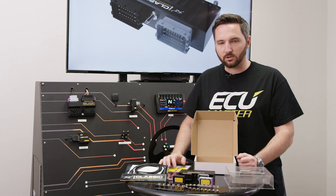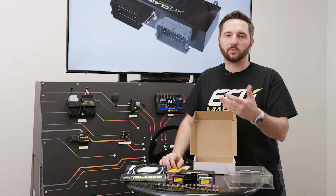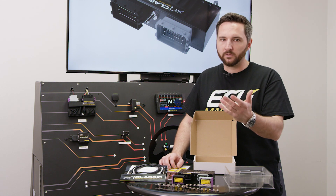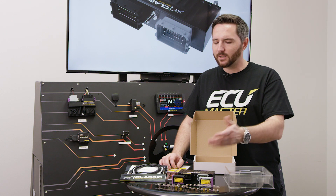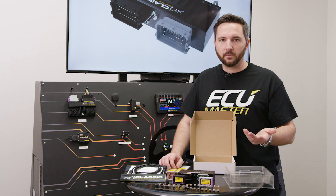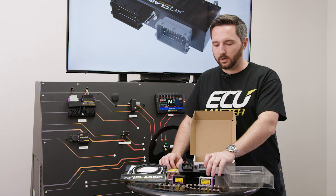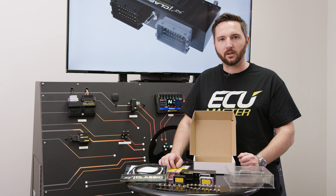The Classic is a great ECU. It has six injector outputs and six high-current coil outputs, so you can drive coils without an igniter, or drive up to 12 passive coils. You can also run up to 12 injectors — two per channel — covering anywhere from one to twelve cylinders, with up to two variable cams. It's limited to cable throttle without an expansion module; if you need drive-by-wire, you may as well just get the Black. But overall it's a great affordable ECU with a lot of motorsport features without spending an arm and a leg.